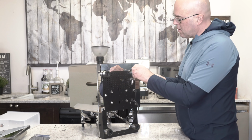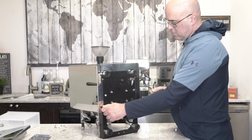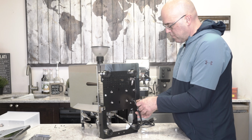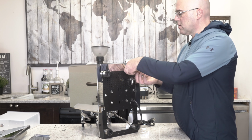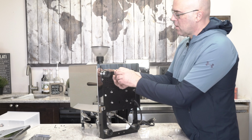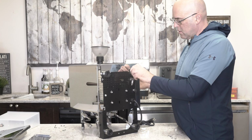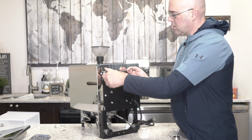you're going to, there's a whole bunch of screws here. You're only loosening the ones that are holding the panel. Okay. And these, sometimes you could just loosen, but it's easier if you just remove them. And these have washers, so you want to make sure that you keep the washers intact with the screw so you know where these go. So we have 4 screws here. And I do like to remove the feet so you don't scratch them.